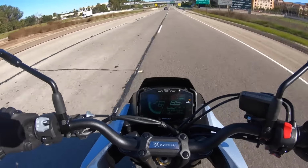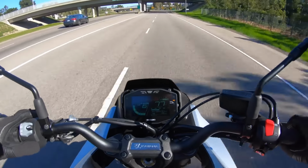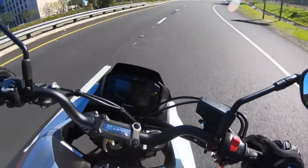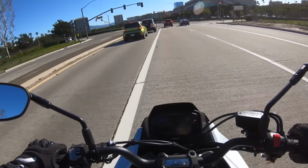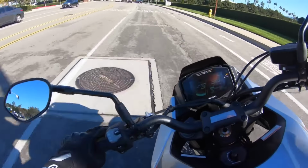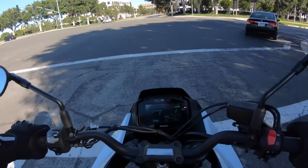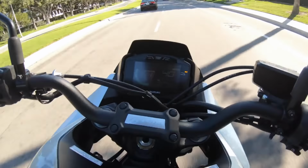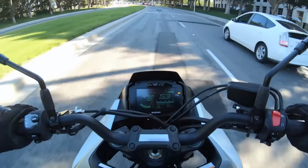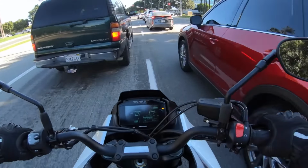This Katana features three-way adjustable traction control, but this TC system is a little bit older in design. Instead of being IMU powered like most modern systems, it only uses wheel speed sensors, crankshaft position, gear shift position, and throttle position to calculate if slip is exceeding the predetermined threshold. So it's better than not having any traction control, but it's also nowhere near as accurate in applying correction as an IMU powered system. But it's still neat that Suzuki fit some form of traction control on this bike.